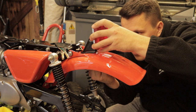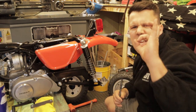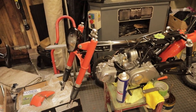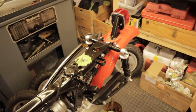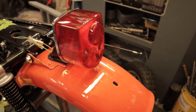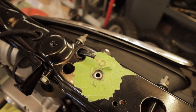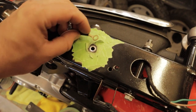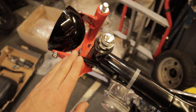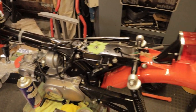We got the rear taillight built up and I have to say this bracket was a pain to get — there are no OEM parts so it had to be a reproduction one from America. Getting this part alone was a proper pain, but I'm dead happy with the end result. Quick update: front end coming together nicely, headlights on with new bolts. At the back the rear light is on, all new hardware, plumbed into the wiring loom. This is the OEM light so they're not cheap but the quality is just perfect. Whilst everything's off, I'm sanding a small area for the coil ground — I don't want paint on my ground so I've sanded it off to get a good earth. Our top yoke is outside drying as I've given it a coat of satin black — I've come this far so let's make sure it's all perfect.